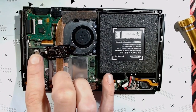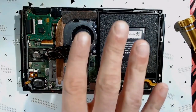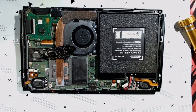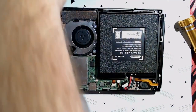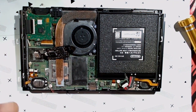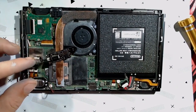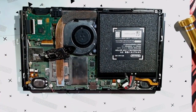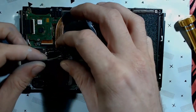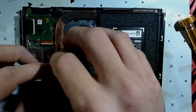You use that USB port if you brick during a firmware update for the mod chip itself. So if it fails to flash for some reason, or you power off in the middle of a mod chip update, you can pull off the back casing, hook this up, and get back in action. Hey, there we go.